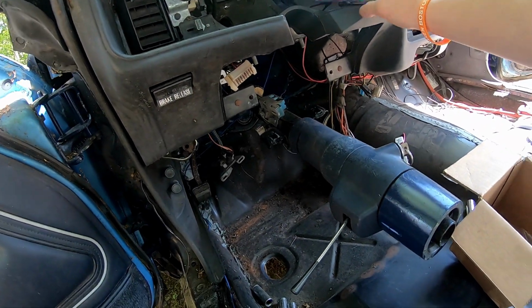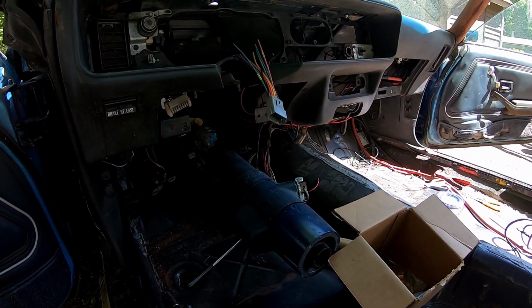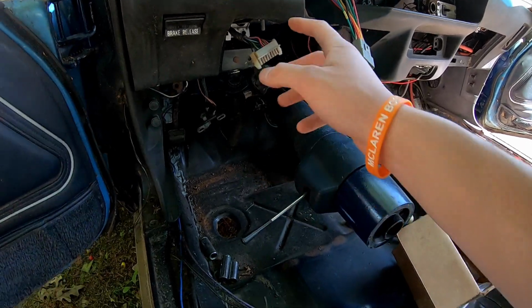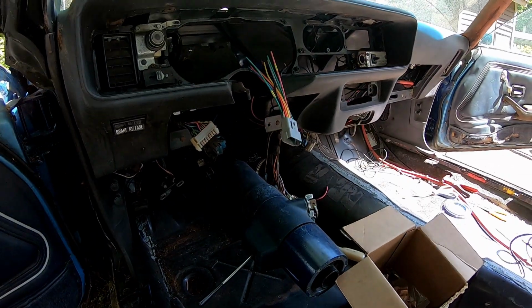So currently I'm about to wire oil pressure. I'm gonna have to do something for the coolant, because I don't think I can tap into the new Holley sensor. I'm gonna also have to grab some of the wires out of this, because one of those is high beam and, you know, turn signals and whatnot, and that's going to go into that.